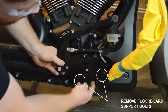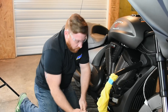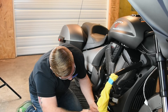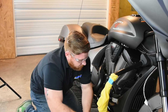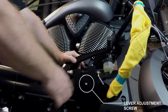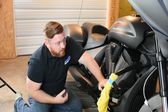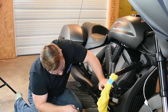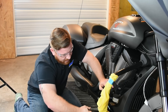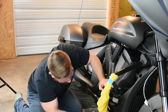What we'll do is actually drop two bolts right here out of the bottom of the bracket itself — it's just got hex head bolts in there. All of this stuff goes into aluminum, so it's a little snug at first, but once you get everything broken loose it goes pretty smooth. Before I drop this all the way out, there is one more bolt right here at the top — that's actually just the adjuster. You can move these controls forward or backwards depending on whether you're really tall or really short. We actually don't even need to touch that one, so we're just going to be taking off these two bottom brackets here. Your entire master cylinder, all of that stuff is going to stay in contact, so we actually won't need to bleed the brakes or anything for this, as long as you're careful and nobody pushes that brake master cylinder while you've got it off.